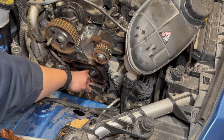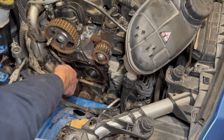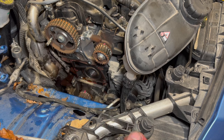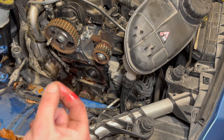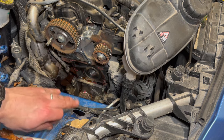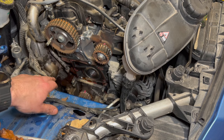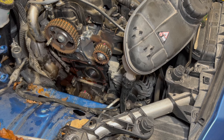The surface is nicely cleaned up and ready for the new water pump. Fit the new gasket — it only goes one way, there's a large blanking piece that just sits out to one side. Put two bolts through to locate it in position, then run all the other bolts in lightly by hand before torquing correctly.